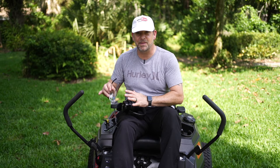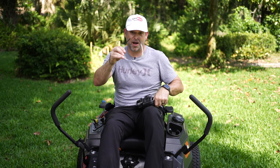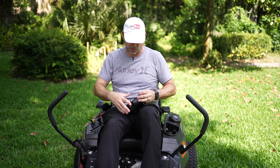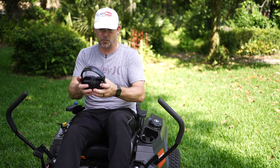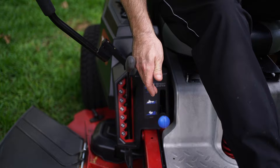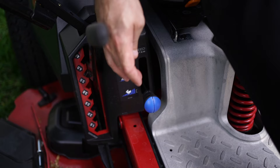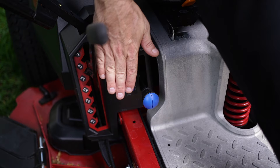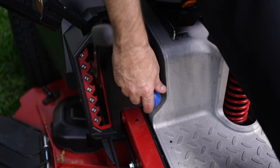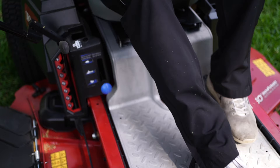I do suggest wearing proper safety equipment — make sure you have glasses on because this thing throws stuff up when you get into the dirt, and you don't want something hitting you in the eye. A little hearing protection doesn't hurt either. One more thing before we get started: the speed control. You have tow, rabbit, and turtle. Turtle is super slow — good for towing something. Rabbit is where I like to mow at full speed. If you're a beginner, you might want to start down on turtle. This just affects the transmission, not the engine RPM — it changes the fulcrum on where it pulls the transmission cable. We're going to go ahead and put it on fast because that's how I like to mow.